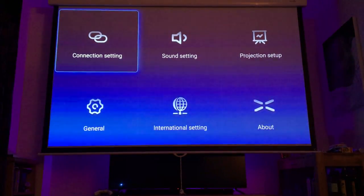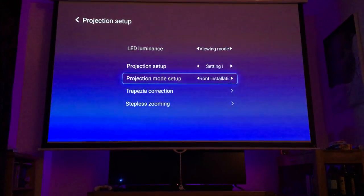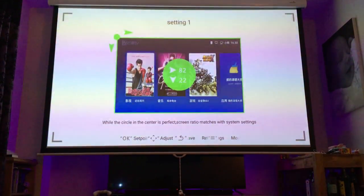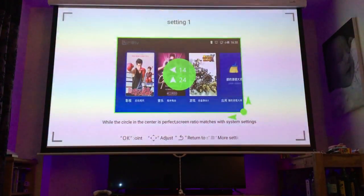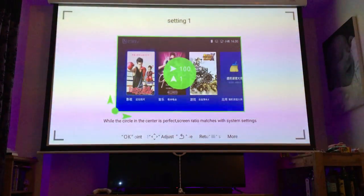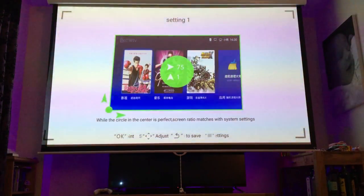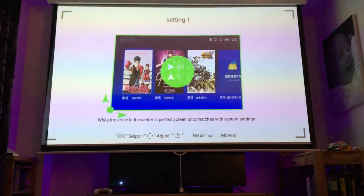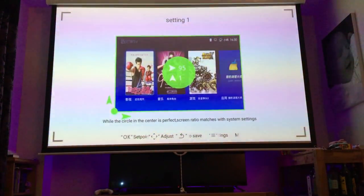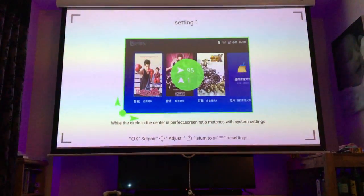If any of those things in between aren't HDCP 2.2 compliant, it won't play it. You get a message on screen saying either your TV is not compatible or whatever's not compatible. There'll be something that's stopping it from doing it. Now that tends to crop up if you've got an older 4K TV. So if you're an early adopter for 4K TV, some TVs don't have the HDCP 2.2 protocol or input. So then they would get a message on screen saying it can't play this 4K content.